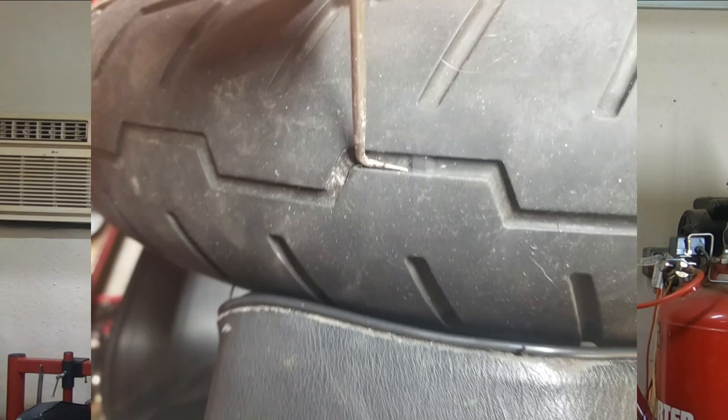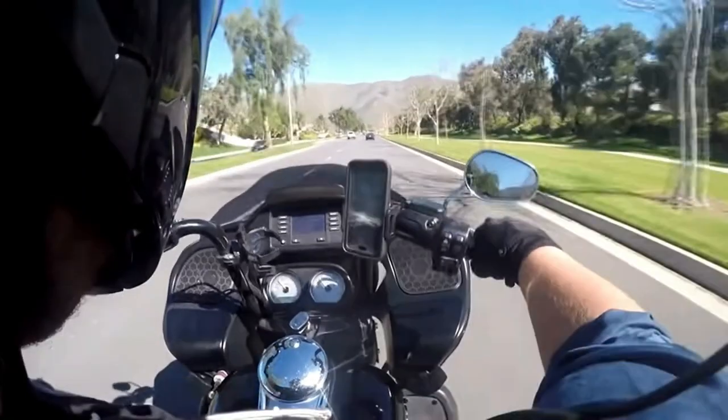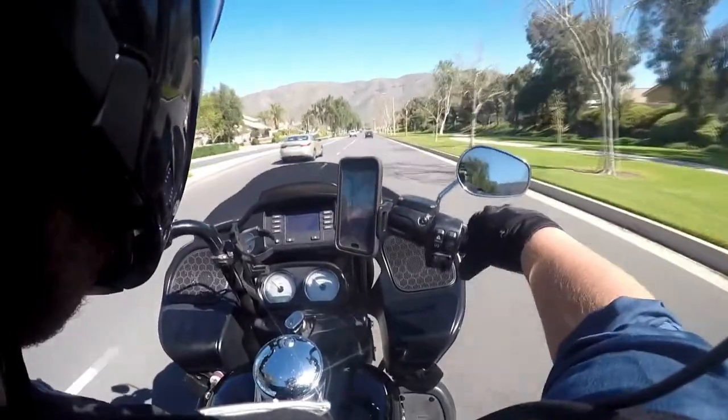Now, I'm going to start with the front tire that I just replaced off my motorcycle. This tire still has tread on it. It is literally just above the wear bars, and technically, it's right on the wear bar. I know you can't see it very well on the camera, so I'll throw a picture up here. It looked perfectly fine. But as I mentioned earlier in the video, I was getting a little bit of head shake. I was taking my hands off the bars and the front end was wanting to wobble away from me. And I'm thinking, all right, gotta be that tire.